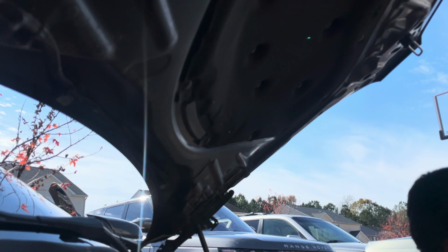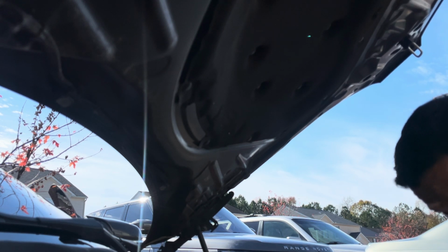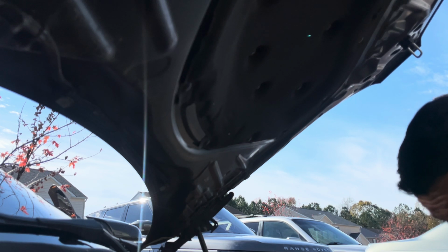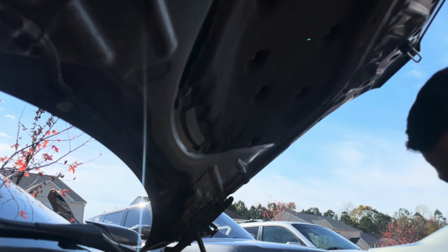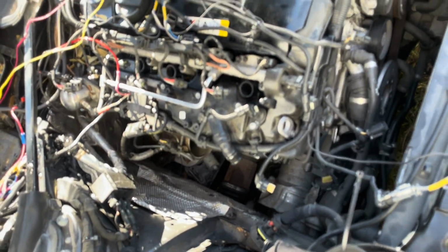All right, cranking this, check this out. Wow, that's what we got coming out of the cylinders right now. So not good. Long day, so you guys saw what you saw. You know, not good having water in the cylinders like that. Mainly just check cylinder 1. Oh wow, man, everything's full.